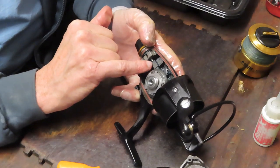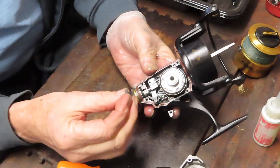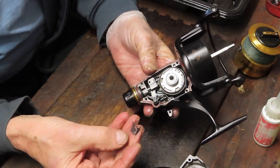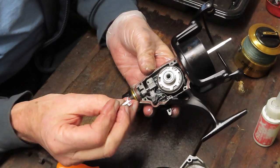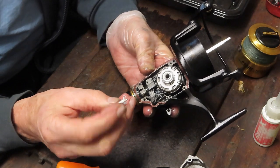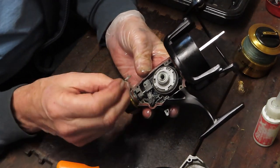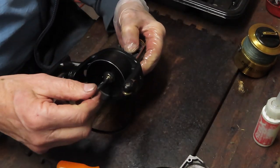This has a U-clip on both sides. We had a question from Australia where the U-clip broke and the part wasn't available. The short answer is: go find the C-clips, because that's all it is — really two C-clips mounted on a little bracket. Put one high and one low and that should do it for you.